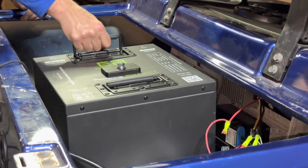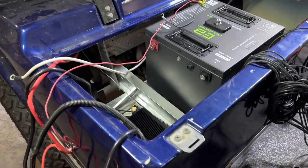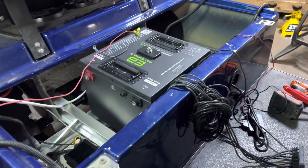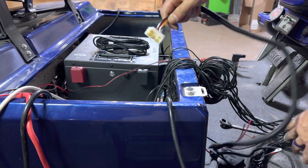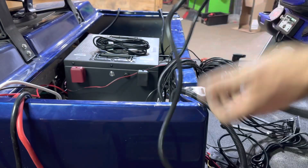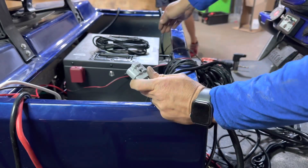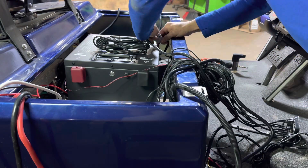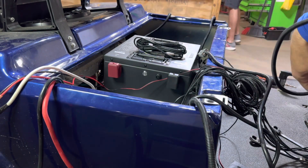Go ahead and bring all your 48-volt supply over to the terminal side, and I have all my 12-volt stuff over here — we have our work cut out for us. Go ahead and get your 12-volt reducer wiring harness and plug this side into the reducer itself. Then get your charger input with the secure weatherproof connection and plug that into the back of the charge receptacle. Now we'll go ahead and run this down through the battery tray and up underneath the cart to the dash.